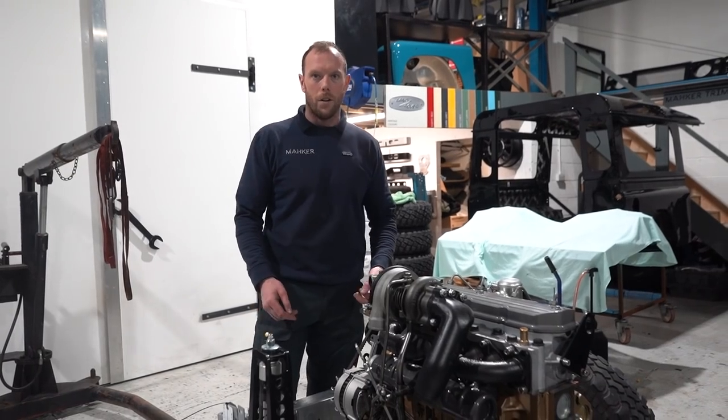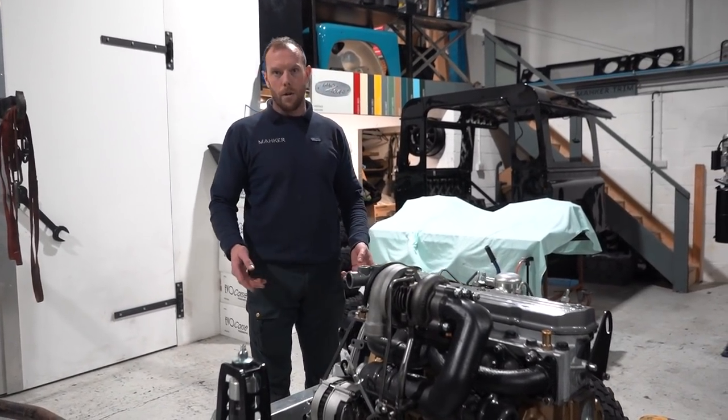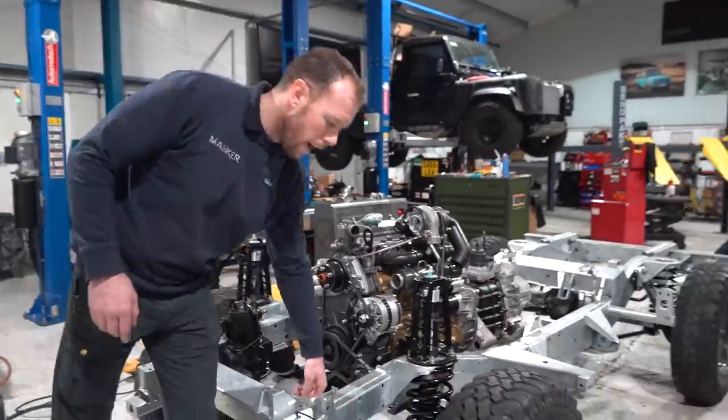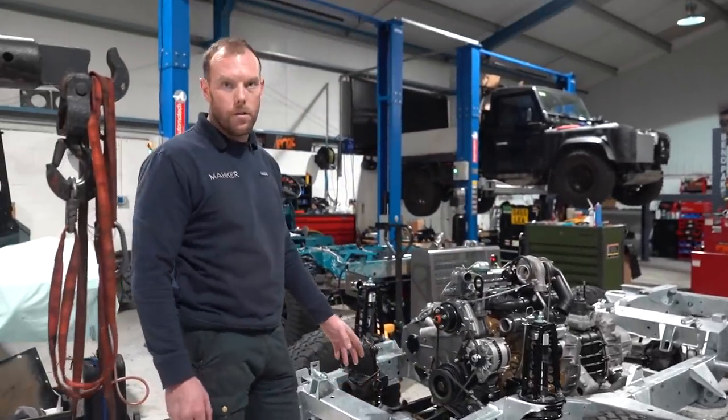So I said to Richard, look, you can spend a couple of grand on some Puma axles, but there's little subtle mods that we have to do, which we call retro modding. So Puma panhard rod, you have to change the panhard rod if you want to fit Puma axles, because Land Rover kindly made these bolt sizes 16mm as opposed to 14mm, which used to be the originals.